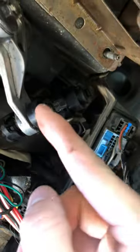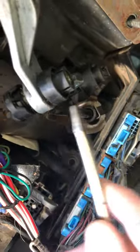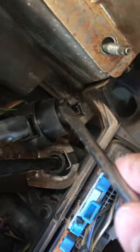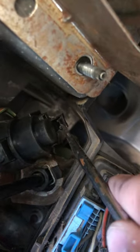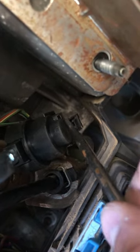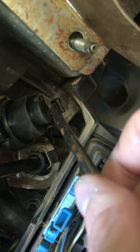To take it out, just get a screwdriver underneath here and pry that out — this will just pop off. There's one more where it connects back here to a pin; pop that out. Then on the side of the shift interlock solenoid there's a little tab right here — click that down and push back.